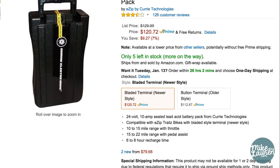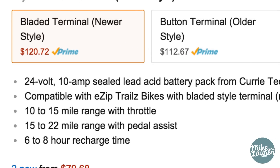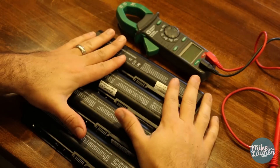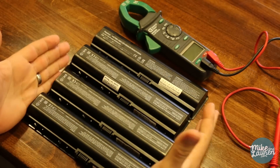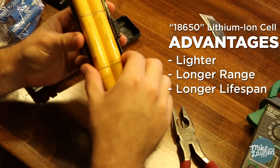If I could get the bike back into rideable shape, a new battery would cost about $120, but the range would only be 10–15 miles. That's when I decided to convert my e-bike to run on a lithium ion battery pack made from used laptop batteries. If my math is right, for about the same price, I'll have a battery that weighs three times less and takes me three times farther.